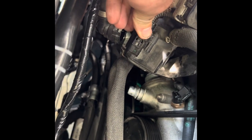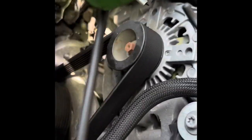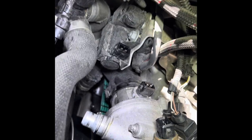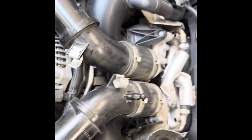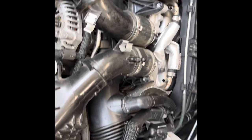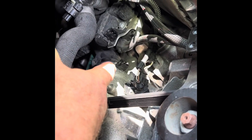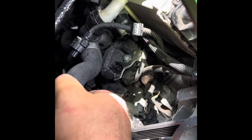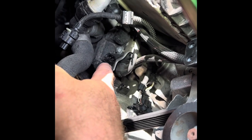This has never been off. Small update: to access the lower radiator hose, there are two pressure converters responsible for building vacuum for the turbos from the engine. I will be doing a turbo job in a couple of weeks, going with Pure Stage 1 turbos, so all this will obviously be disassembled anyway. I planned on replacing vacuum lines as well as pressure converters. Since everything is wide open right now, I'll go ahead and do it — loosen the lower radiator hose that snaps onto the water pump. There are a couple of 10mm bolts and a plug, same on the other side.